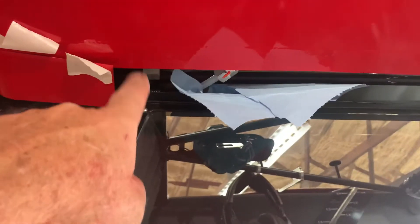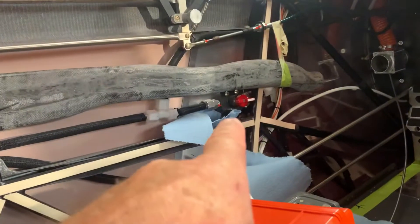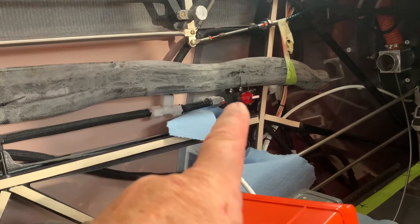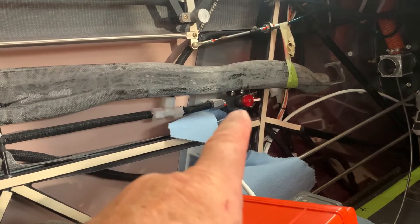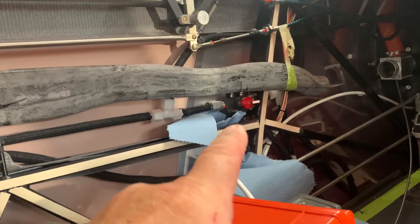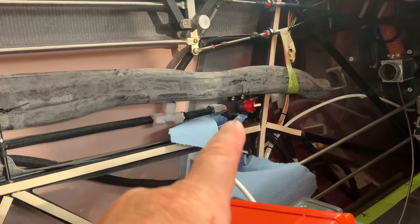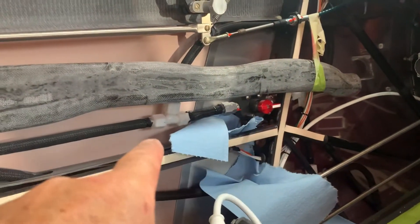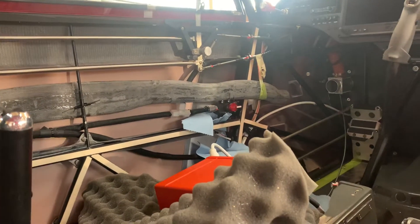I'll leave these panels off until after I've got this fuel in. I'm going to leave the fuel in here overnight or maybe for a couple of days and make sure there's no fuel coming out. These would probably leak immediately, and you can run your finger on them and see the blue. The fuel selector has problems with O-rings being dried out because they haven't been used. The fuel seeps — there are little balls with O-rings, and when those O-rings dry out, they get a chalky substance and begin to leak. It doesn't leak fast enough to see readily. It seeps out, lands on the stringer, and eventually bubbles your paint on the outside. About two months later, you'll see it.